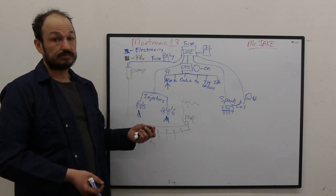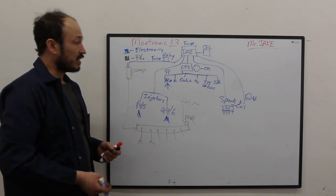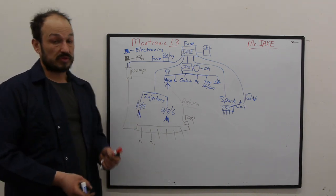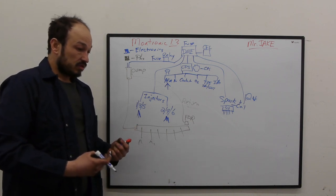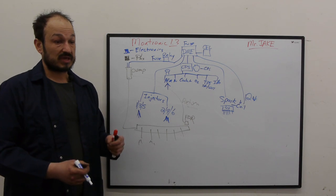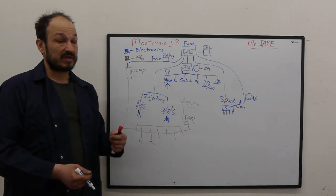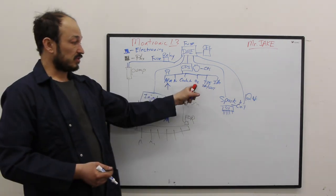A lot of information. But it's not that complicated when you start looking at it in this way, and you start thinking backwards through the system. So when I try to diagnose anything, I try to simplify as much as I can. Disconnect sensors, okay? As we saw from that last video, the thing's gonna run with a lot of stuff unplugged. The oxygen sensor, it's not needed.